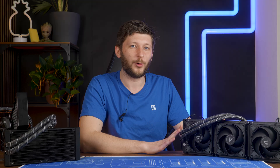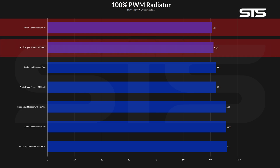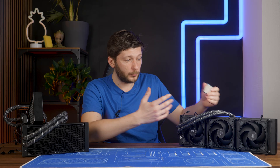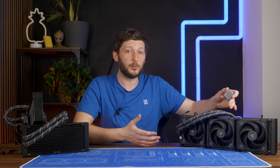Please do not do this — everything about this is wrong. As a small reminder, an original stock Arctic Liquid Freezer 420 using P14s was capable of keeping 200 watts pushing a 13700K at 60.6 degrees C above ambient — a bit better than the 61.1 degrees C achieved by the 360mm using P12 Maxes, though that one was a lot louder. What happened when we fused the enormous size of the 420mm radiator with the clearly illegal speed of the P12 Maxes?